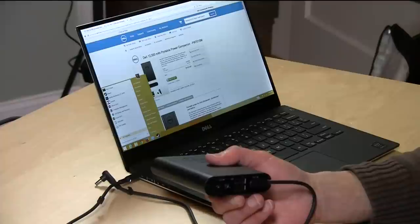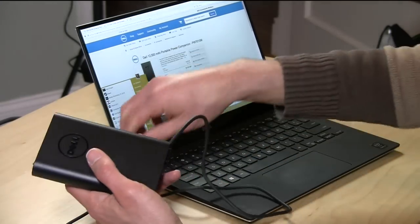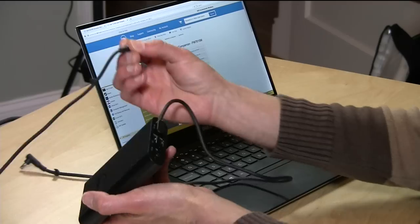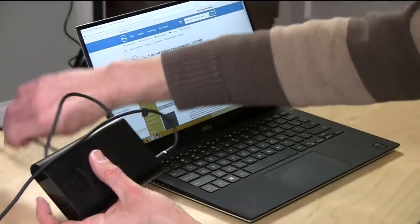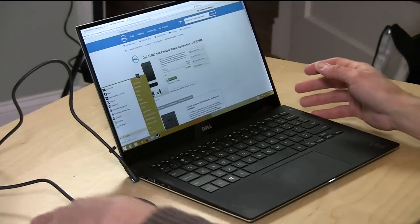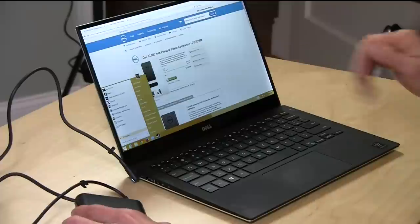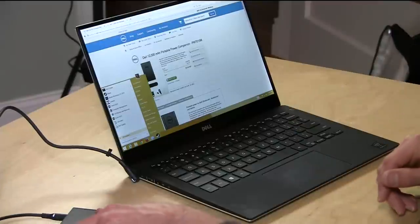The battery is limited, so you're not going to get a full charge on the laptop from it, but probably enough to give you another 15 or 20 percent or so, which is pretty handy. It's about $120, so it's a little more expensive than some battery packs out there, and it also needs to be charged with the Dell power adapters. You plug the Dell power adapter into here and then plug this into your laptop, so on wall power it draws through the adapter through the companion into your Dell, and unplugged it runs the battery to charge while you're using the computer. It's handy to have a single battery that charges everything in your bag as a safety net when traveling.